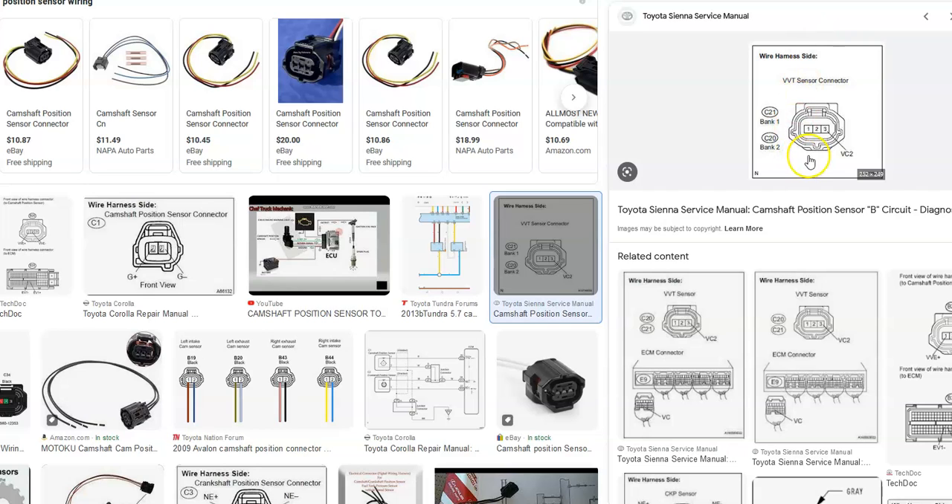The wiring is easy to look at as long as you have a meter. Older Toyotas had two wires, some newer ones could have four, but by far the most common is three wires. You'll have a ground in the middle, voltage on one of the outer pins that's always going to the plug when the key is in the on position.